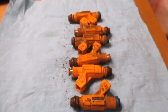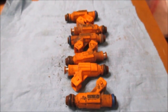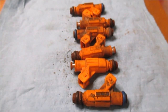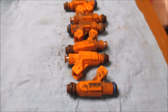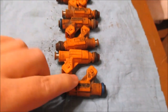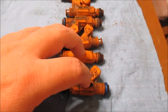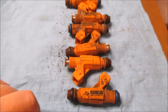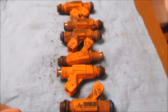Here are the six injectors I pulled out of my 1999 Ford Explorer 4.0 single overhead cam. I consistently had a lean condition on my vehicle, and I did a pressure balance test on these injectors. They tested at different pressure drops, so that leads me to believe they're plugged up. So instead of buying brand new injectors, I thought I would try an online service.